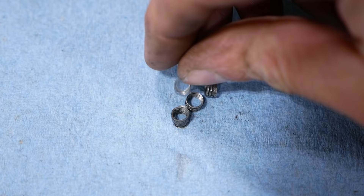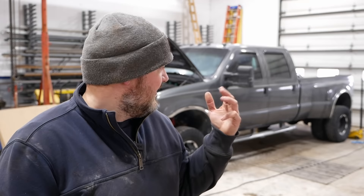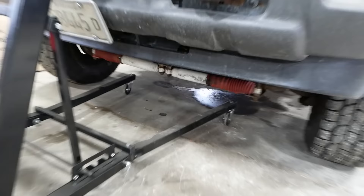This is a 2003 Ford F350 with the 6.0L Power Stroke. It's got a bunch of problems. I did a short video about the driveline — it had three bad U-joints, two bad yokes, and a bad carrier bearing. I've got that fixed. It has some drivability problems with the engine and it's also leaking pretty much every fluid from every place it can leak, both coolant and oil.